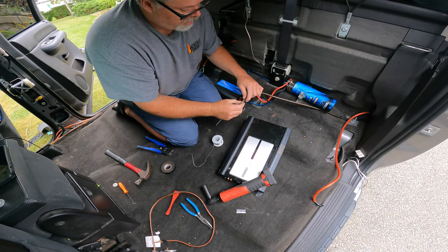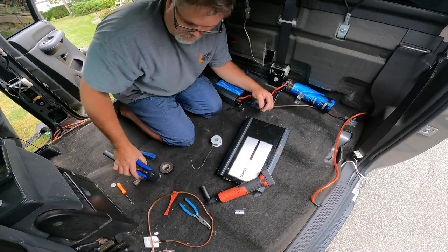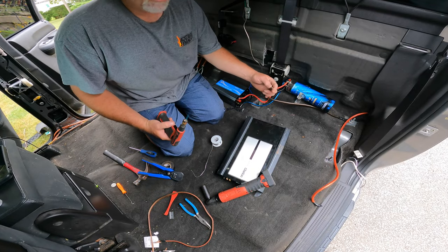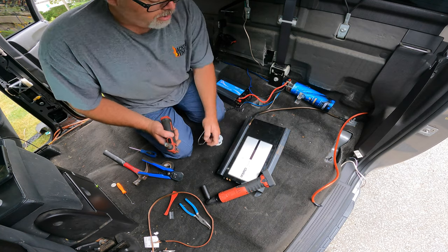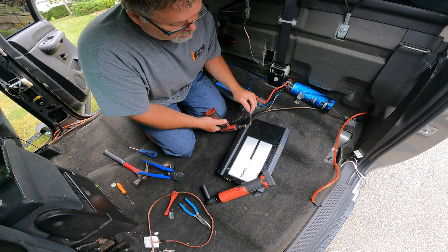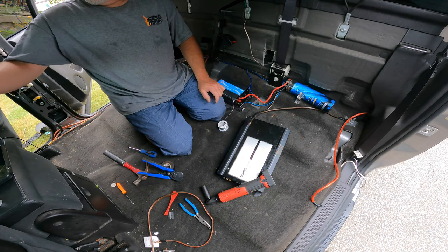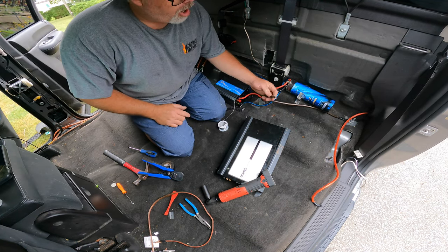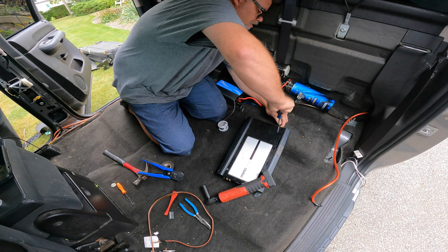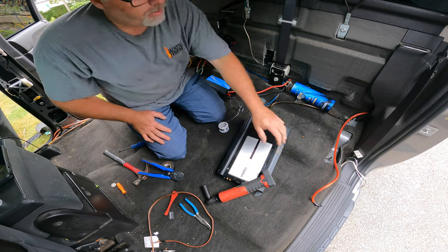That wire is just cocked over — make a new end for that too. Now, if you're wondering why I'm soldering this: if you don't have the right connections for your amplifier and you solder it, it keeps the wire stiff so when you screw it down it doesn't crush the wire and give you a bad connection. Throw some solder in there, it makes it nice and tight — see how much better that solder works. So now when you put it in the amplifier it'll be hard and you'll get a good screw bite on it. Stick her in and tighten her down. So now we repeat the process with the power wire.